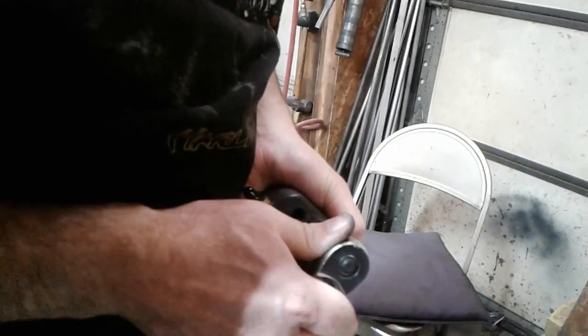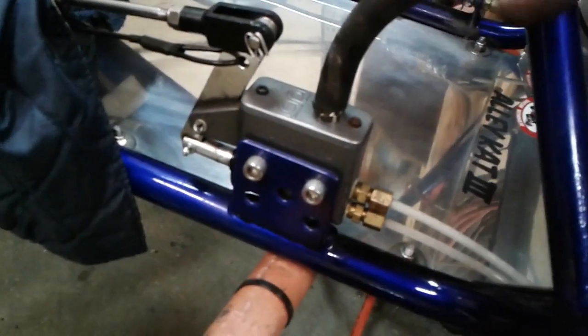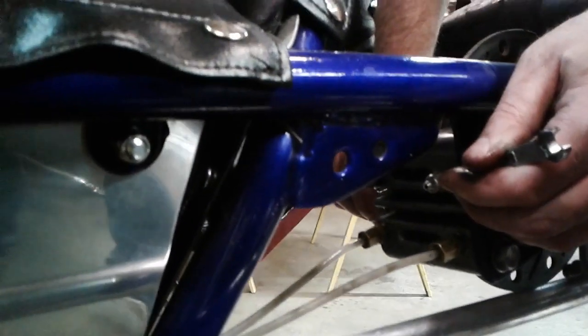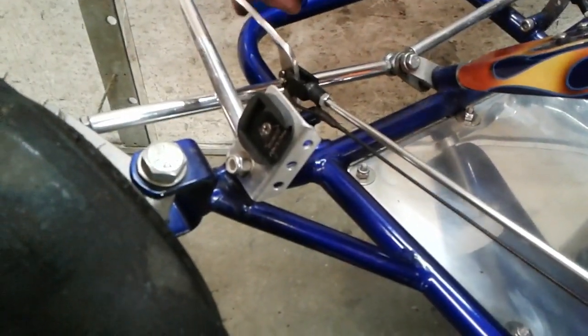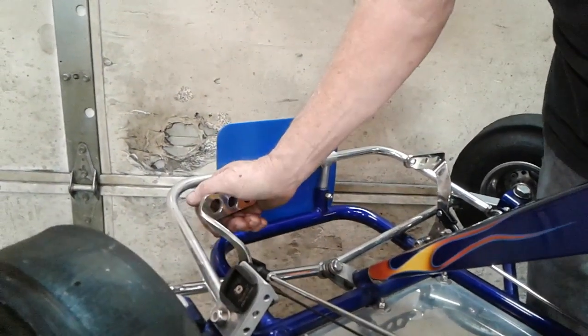He's tightening up the inner screw that holds the brake lining on. So how tight is that, Sean? Good and tight. This is the shop method for bleeding the brakes — put a quarter-inch fitting in there with a piece of hose. Most of the time I do this as a one-person deal, but in this case we'll put a little air to it and push that fluid to the back while he's got that open. When you use that brake bleed method with the hose, you're done — there's no air left in those lines, the pads are all adjusted. That's our travel with a fully bled system without a single bubble in the line.